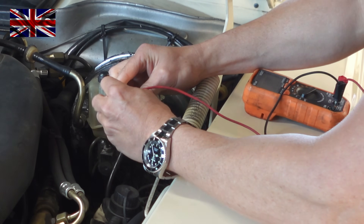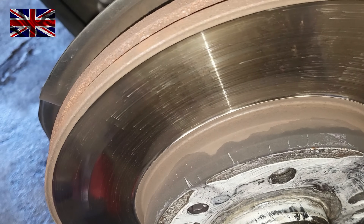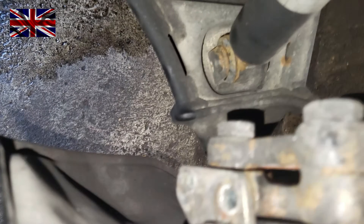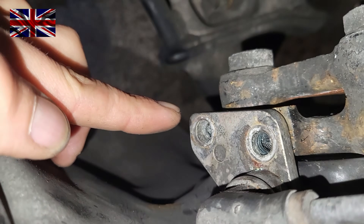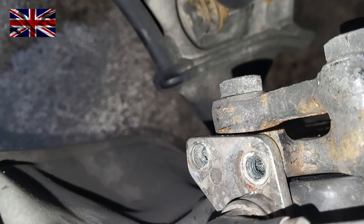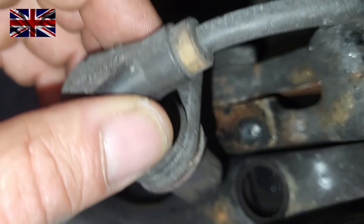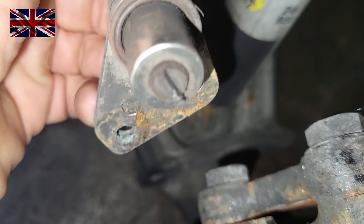Move on to the wheel arch — you need to turn the brake disc to see a result. To get to the sensor you need to remove the rim. The assembly is held in place with two imbus bolts. This is a simple mechanical sensor — dirty, isn't it. We'll give it a wipe. I put it back in place to check if it is still making contact with the notch in the disc behind the brake disc.